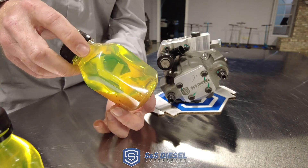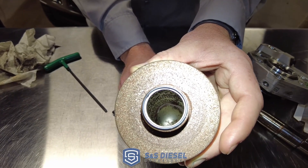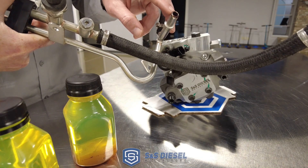We've even seen that recently with a field test truck — an early truck we were doing prototype testing with. The customer had it for a few months and come to find out he ended up getting a bunch of water in his fuel without knowing it. There was a lot of rust in the system — the filters themselves were rusting because they were metal spin-on filters. There was lots of water, rust, and contamination. But luckily they had a DCR on board, and even though it showed signs of damage and debris inside from eating all that contamination, it lived just fine. We took it apart, inspected it, put it back together, and put it back on the truck. A CP4 would have died a painful death and taken everybody else down with it.